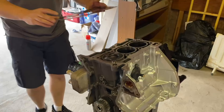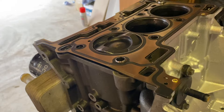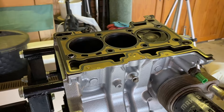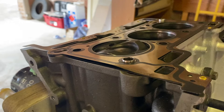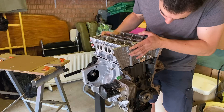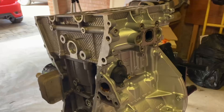I'm aware there are additional sealing products like Well Seal that you can use between the head gasket and the mating surfaces, but since I've never done a head gasket before and haven't had problems, I'm not going to use anything like that at this point — though if I encounter problems in the future, that's something I'd look at. I'm giving the bottom of the cylinder head one final clean, then setting it in place on top of the new head gasket, and now it's actually starting to look a little bit more like an engine again.